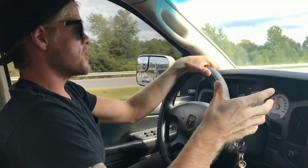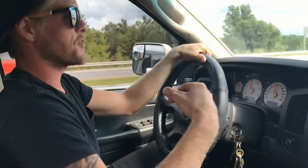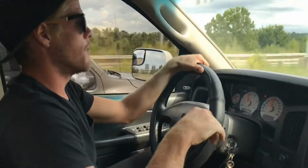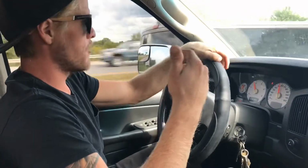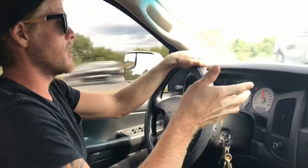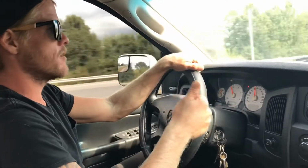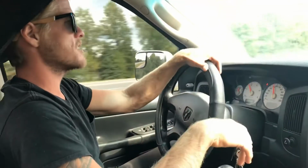All these third gen Dodges, they have got some sloppy steering, and they're known for it as well. Any Dodge for that matter, really. Second and third gen. Fourth gens, nothing to brag about either. Sloppy steering, but as we're driving along, this thing's tight, and then I remember it's got the dual steering stabilizer kit from Rough Country, and that's what I got on my other Dodge, but we have no driving time on that steering stabilizer kit, so nothing to say for it yet.